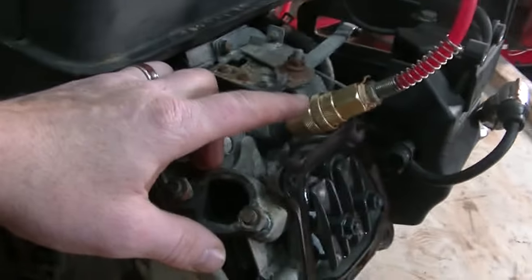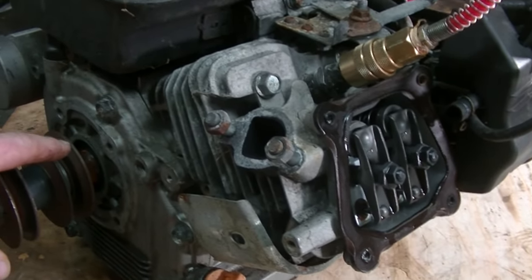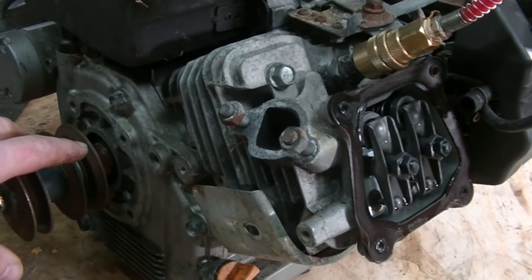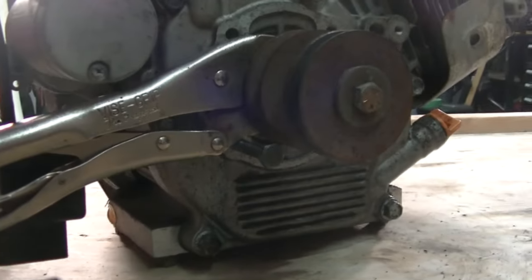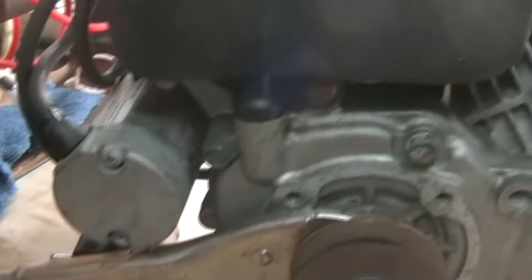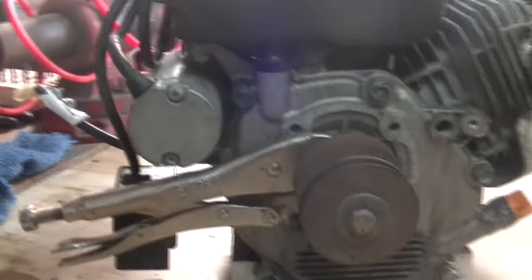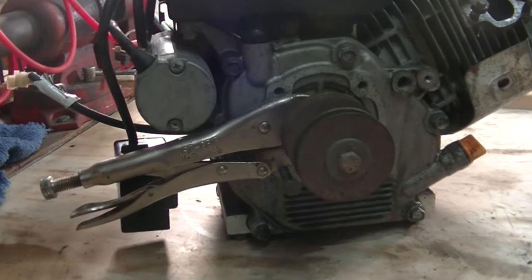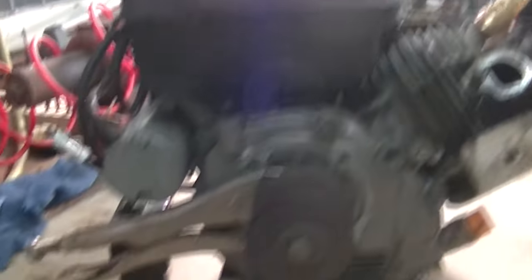What you want to do is rotate the engine so you've gotten past that little extra bump and you're sitting on the base circle of the cam with the valves closed. Then you need to find a way to hold the crankshaft still. I've got my air connected but the air valve is off. Be careful: when you turn the air on, if the crankshaft is not held firmly, it will violently throw the piston down and you could take a finger off if you're not paying attention — I damn near had that accident. Connect the airline without air flowing and turn it on at the compressor from a distance.